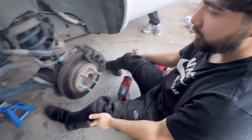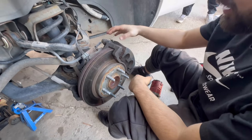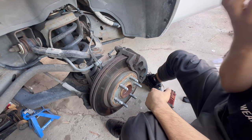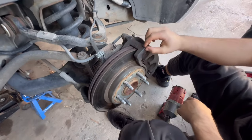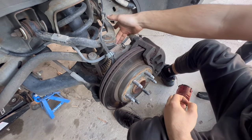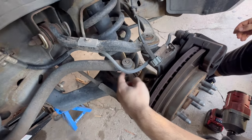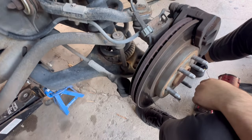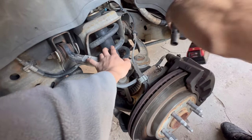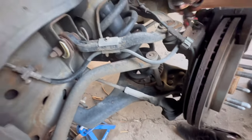Tell me what you're doing Dago. I gotta take the brake caliper off, I basically gotta get the spindle off. I gotta take the caliper and then the rotor, and I'm gonna take the ball joints off — the top, the bottom — and then the tie rod and the sway bar. This is our mechanic of the group. I just bought some springs and spindles, gonna drop four inches in the front.